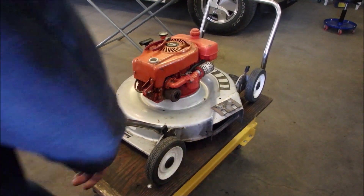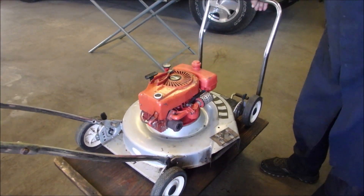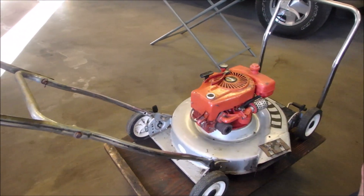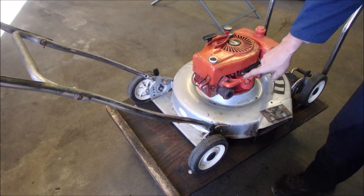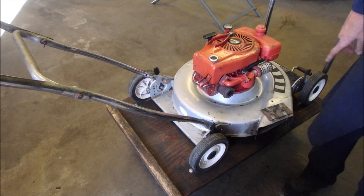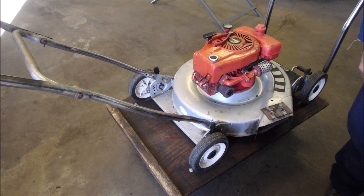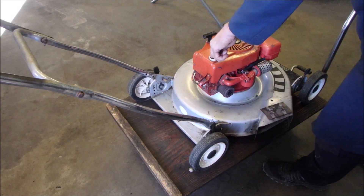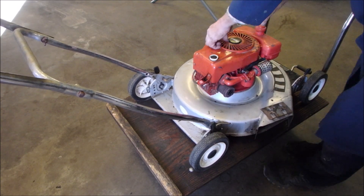Okay, now the next thing I'm going to do is spray some carb spray on this seam here where the new gasket is — that's the ultimate test to see if you've got a good gasket. I'm going to lower this all the way down. That's a dangerous height — you guys might have seen my coat was flapping in the wind from the blade, that's bad. So let's start it up.